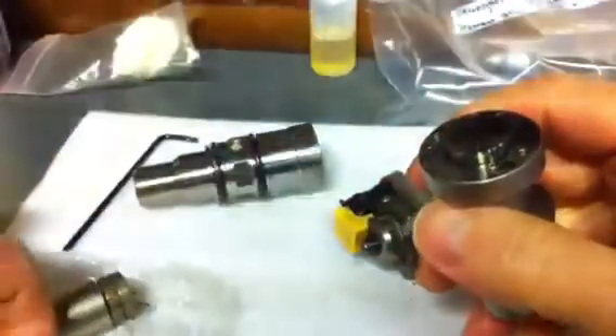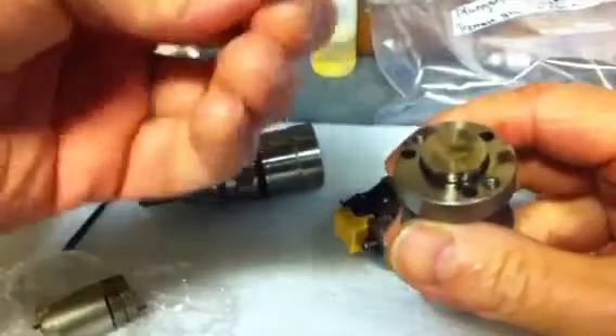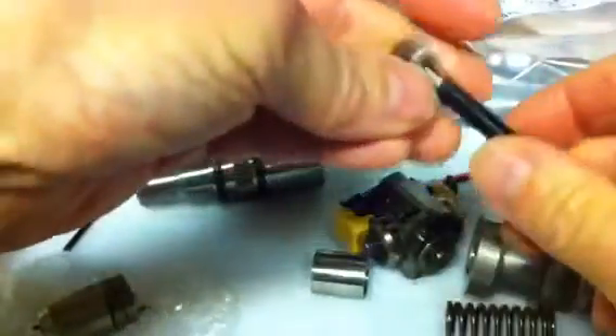That's where all of the oil goes in down onto the intensifier piston, which is right here. Normally you would have a shim sitting in this position — that's about 0.026 or 0.025-ish in thickness. This is the intensifier piston, and underneath that you have the plunger and the cap. The plunger in this one has been modified.